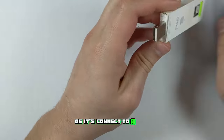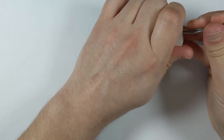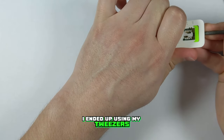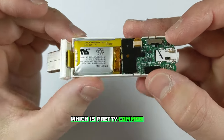You've got to be careful when removing it as it's connected to a flex cable that attaches to the PCB — that's probably the most fragile thing on this iPod. To slide the internals out we'll need to push them down through the headphone jack, so find something that'll fit inside there and push it through. I ended up using my tweezers, but obviously be careful not to break it. There's quite a bit of resistance pushing mine out as the battery had started to expand, which is pretty common on these old iPods.